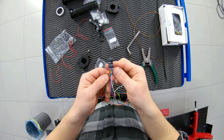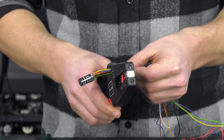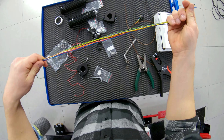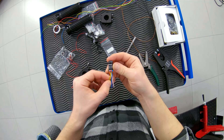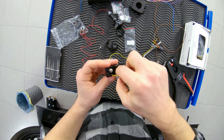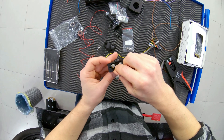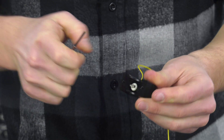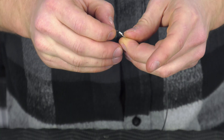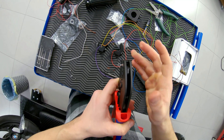The M-button relay is equipped with long thin wires, which are perfect for push buttons. There are no such wires in the MotoGadget kit, although they are the most necessary and rare. Connect the push buttons according to the colors indicated on the M-button relay. This relay combines all the wires into one, which will go to the M-Unit. This will greatly reduce the thickness of the braid from the headlight.